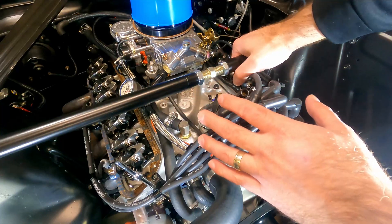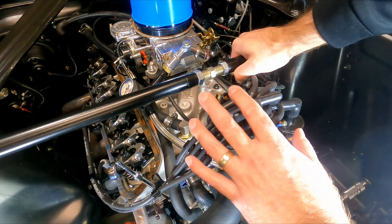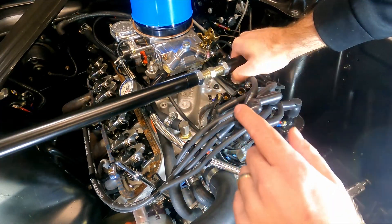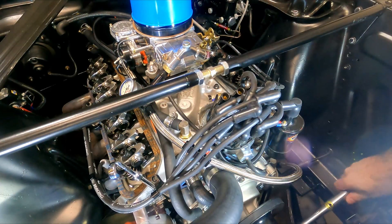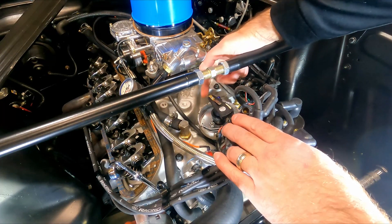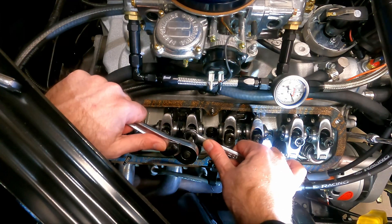You're also going to need to know your firing order for your car. This is the 351 Windsor firing order — that's the formal term — and my motor uses that firing order, which is not the same as other Ford motors, particularly the one that originally came in this car. So you're going to want to know your firing order. In my case cylinder number three is next in order, so when I rotate the crank — there — now this is pointed to the next sharpie mark and I know cylinder number three is ready to go.